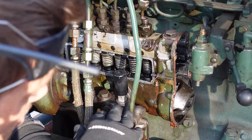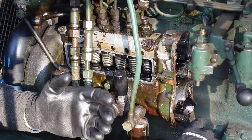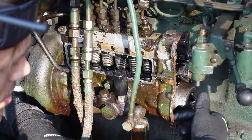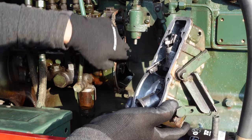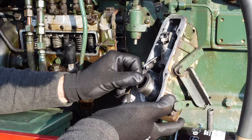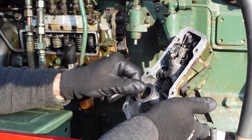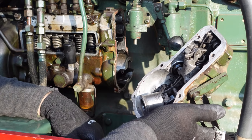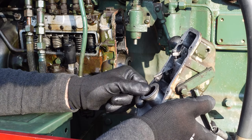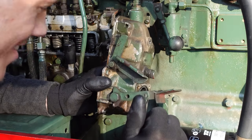And the camshaft pretty much goes to the governor. And the governor is meant to keep a consistent RPM. So this just works with centrifugal force. This pretty much goes inside here, and the more the engine is revving, the more these will open up, pushing this thing in. Everything here is kind of connected, but this has the last word to say. So this lever here is what is connected to the throttle, which in turn is connected to this. What happened if... Well, they're in the bucket.